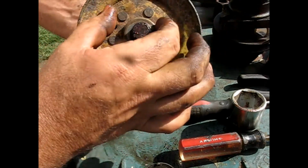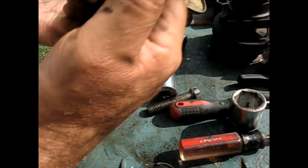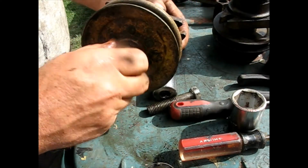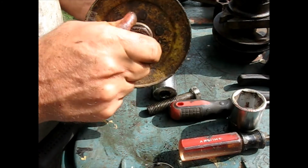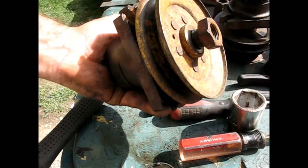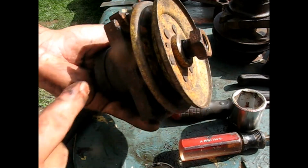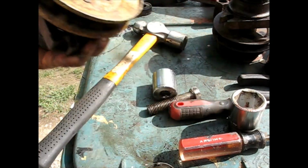It's another important thing. The height of the pulley, it'll be offset one way or the other. Oftentimes it is. And then we'll just tighten that nut down. The best way is with an impact driver. That way you don't have to hold much with the other end.